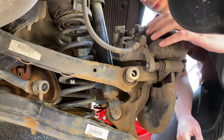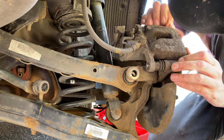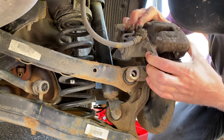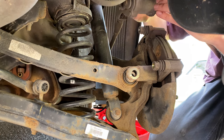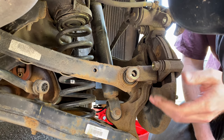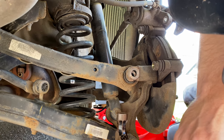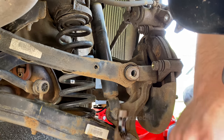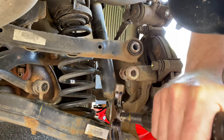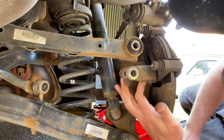The pads on here are well shot - I should have replaced them a long time ago. So there's a bit of a lip on these discs as well, so I'm not expecting this to come off very easily. Easy done. At least we can now get to our suspension arm and see if we can knock that up out of the way. What you don't want is a load of crap in your eyes when you're doing this, so it's worth some eye protection. You can see I was hardly giving it any taps at all - that wasn't too difficult. And we've now got access to this bolt!